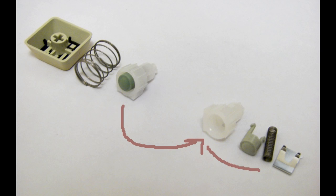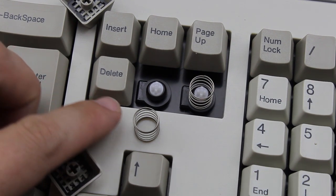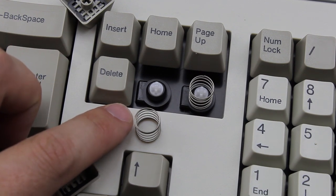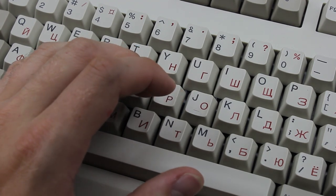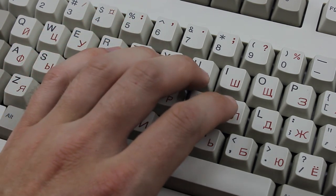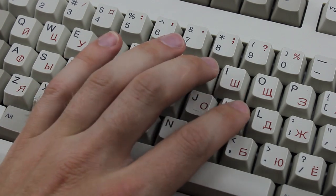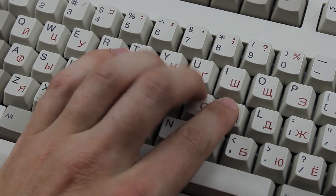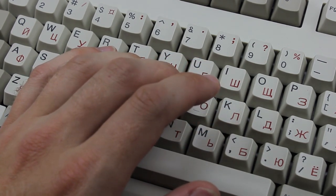The switches consist of a pusher clipped into a slider with a coil spring between them to extend the pusher outwards, and this arrangement presses down on a standard triple set of membranes. In order to make the slider come back up again, it's got an external coil spring, and there's a small recess in the barrel plate for an Alps-style click leaf, which provides tactility and the clicky noise. It's probably what people would describe as a mechamembrane switch, similar to Razer's design, although unlike Razer mechamembrane, it doesn't use rubber domes, has a much thicker click noise, and the click leaf itself does actually impart tactility, rather than being there just to make some noise.